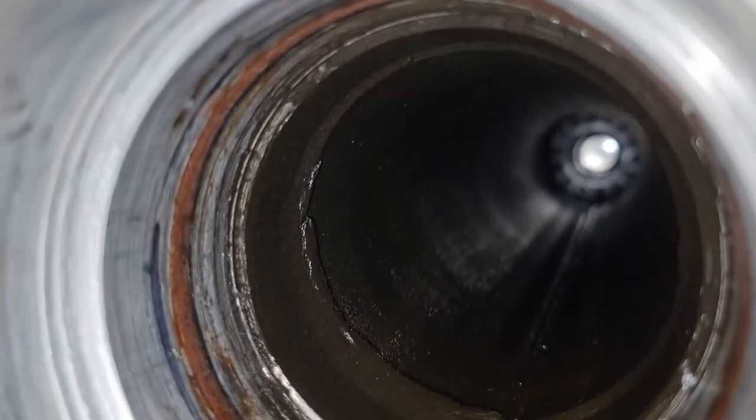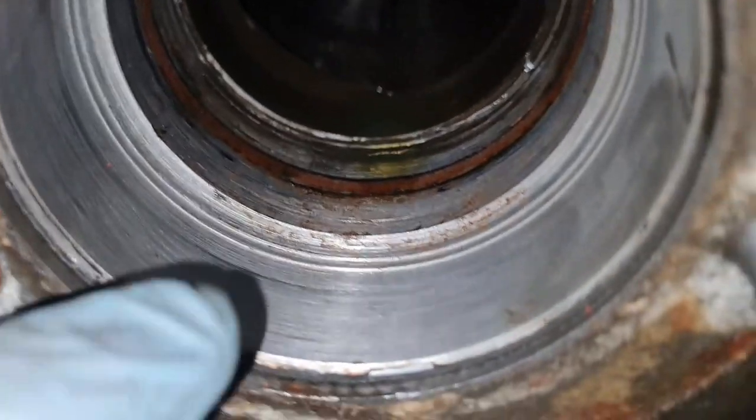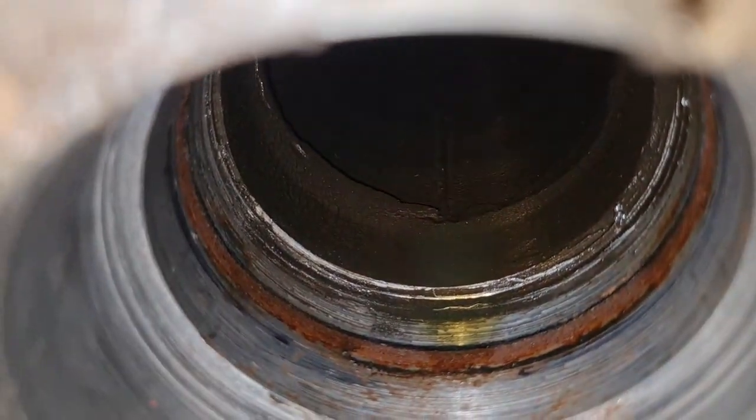If you remember earlier, the black ring on the half shaft is obviously caused by going around on the rubber of the inner seal. If, like this one, it's been in there since factory, I would have thought you get some kind of wear on the half shaft. If you put it back in exactly the same place, then you may not be getting the seal as you would if you moved it out a couple of thou, you know what I mean? So ideally, just push it in just that fraction more or leave it out just a fraction. But you have got plenty of room to go in further if that's what you want to do. I'm going to clean this up now, and then we'll put the new seal in.